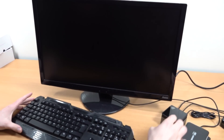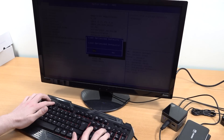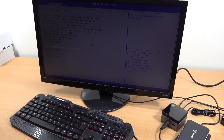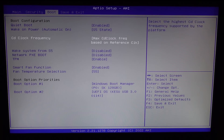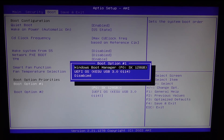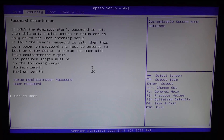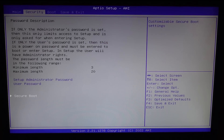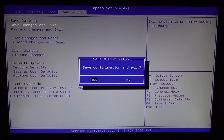The first thing I'm going to do is power on and figure out which button gets us into the BIOS. I'm just pressing every button because I have no clue at this point. To set up a drive like Batocera, we need to disable Windows or at least make sure it doesn't boot up. In boot priorities, I'm setting the USB thumb drive — or in this case the hard drive — as number one. Also check secure boot and set it to disabled if possible. Save changes, exit, reboot the device, and if everything is as it should be, it will boot into Batocera.